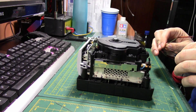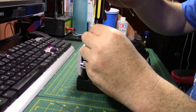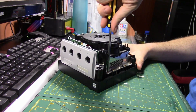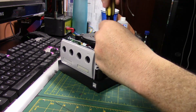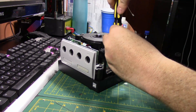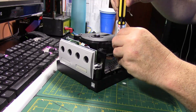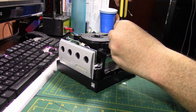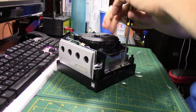Hey everybody, it's Chris from Red Zone. I'm doing a follow-up video to the GameCube mod chip. It's funny how every time I want to do one of these videos, the dogs start barking — it's like they know. So I still have the old mod chip in here that didn't work. When I fire up the GameCube the mod chip stays red. I thought maybe since I got these mod chips off AliExpress they may be bunk chips, but the red light may indicate I screwed up with the wiring. These mod chips are designed to be soldered directly to the board but I opted to go with wires in case something didn't go right — which in this case it did not.